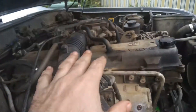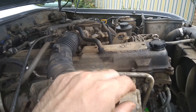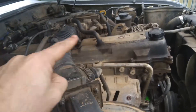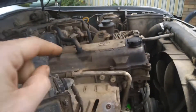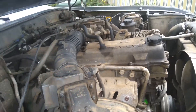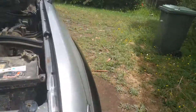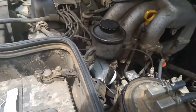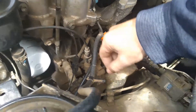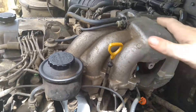Also the throttle body. I'm obviously going to have to do another major service on this over the summer break again — it's going to be due for another big service. I probably won't do spark plugs, but I may do leads if I've got enough money, because the leads on this are not cheap. The other thing that could be bogging your system down sometimes — and I've had this happen — is the spark pack. You can see it's all filthy. If you haven't got a good clean spark getting to the system, that can also weigh this motor down.